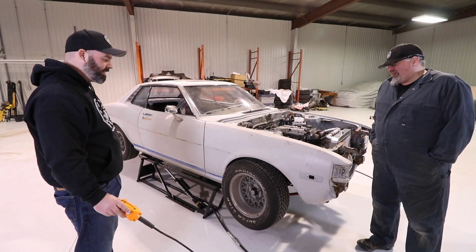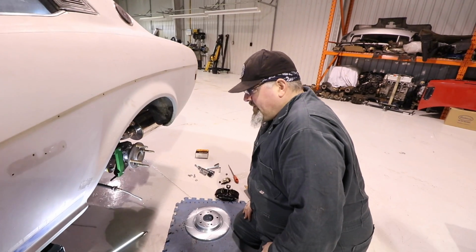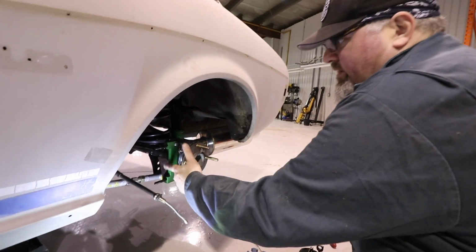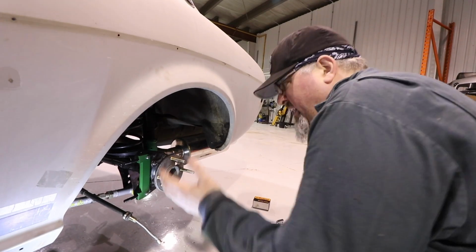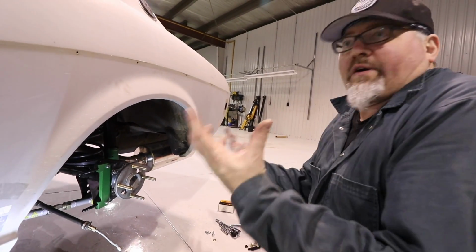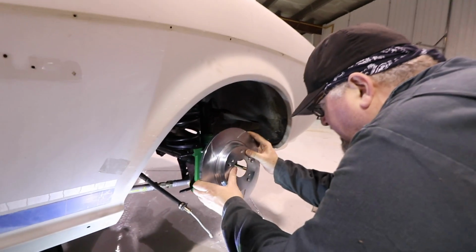All right, let's take some wheels and tires off. How goes the battle, Moose? It's going. I'm sort of doing a test fit here. I've got the caliper radial mount adapter in place. I just hand fitted in the studs for the caliper. Now I can put the rotor on and we can bolt it down, test fit it, make sure everything's good before I go permanent with Loctite and all that fun stuff. Right. So we'll just get this thing up.